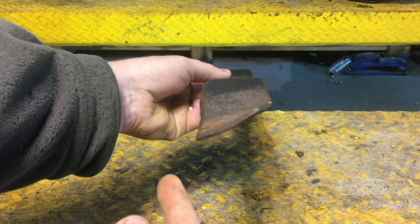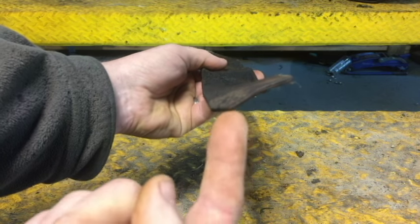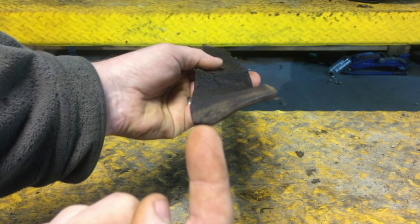Every lawnmower blade has a wing that comes up off the back side of the blade when it's on properly. If you have it on upside down, that wing is now closer to your grass — especially if you cut low. You can catch that wing on stumps or rocks, bend your blade, shear your flywheel key, and worst case scenario, bend your crankshaft. In today's day and age, a bent crankshaft means the mower is garbage — nobody is going to straighten or replace it.